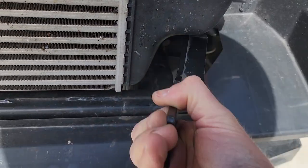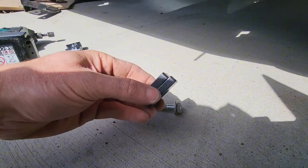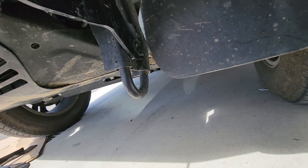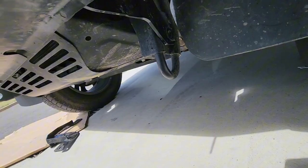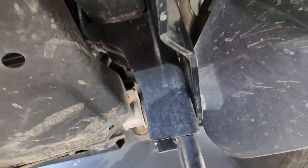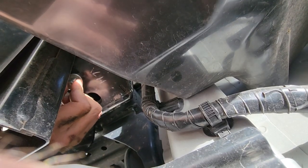On the right-hand side of the car, grab the bolt through — you'll see in the instructions — and you'll need your two spacers here, because that's going to make up the gap. Thread the bolt with a washer through that, then put the nut and washer on the other side. As you can see, bolts are through, two spacers are there to make up the difference, and the nut and washer is on the other side. We'll start to locate that.